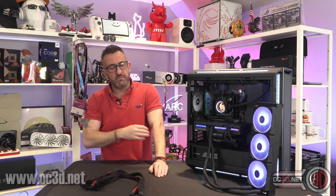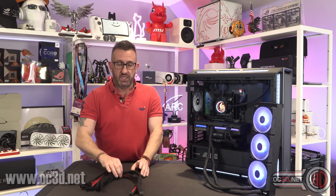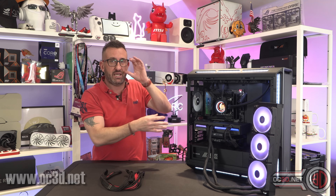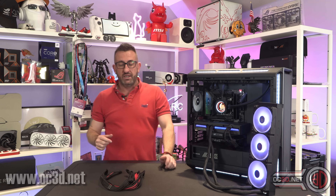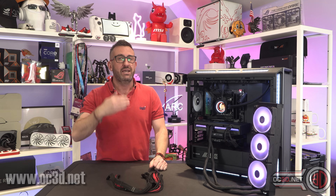The ASUS software does give you a useful hint about what's going on in your rig. If you change your graphics card a lot, move your system around a lot, or you're planning really crazy tight cable bends, I would definitely suggest buying a new cable when you buy a new graphics card. I know a single cable isn't particularly cheap. If you've got a new power supply going in, you're probably not going to have a problem. But if you're investing multiple thousands of pounds — and I really only see this as a critical issue with the 5090, possibly the 4090 — and you're not buying an ASUS card so you don't have that software, treat yourself to a new cable for the safety headroom.